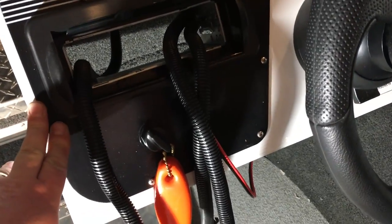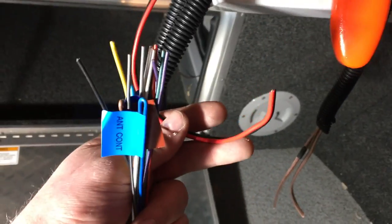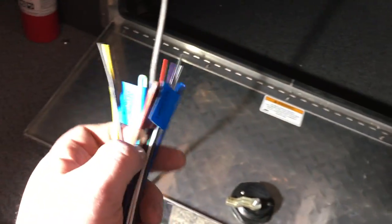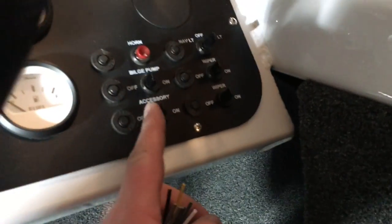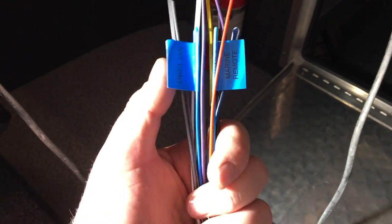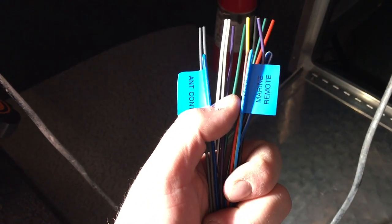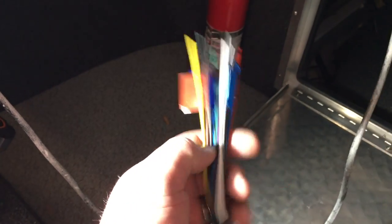At this point we'll be taking the wiring harness that came with our radio. With the radio harness, power is yellow and ground is black — those will hook into our power and ground that we've run all the way back to the battery, and of course we'll put a fuse on it. The red wire — we've discovered we're either going to use this accessory switch which isn't currently used, or put it into the ignition directly so you have to turn the key to boot up the radio. The other wires taped off we're not going to use: one's the antenna, one's the remote for an amplifier which we don't have, one is for mute, and one is for steering wheel control.